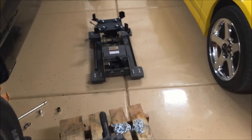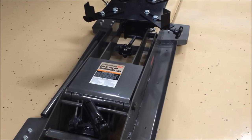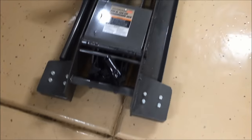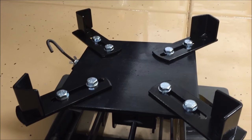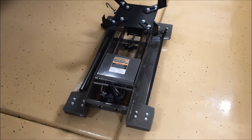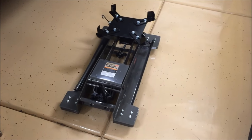One tool I would highly recommend for the job is a transmission jack. You're going to use this multiple times. They're about $150 at Harbor Freight, which isn't really a lot of money, and you're going to use it to lower the transfer case and the transmission, so it's really going to come in handy. It's somewhat similar to a normal jack but it just has a platform up here that helps you secure the whole thing, because you do not want that transmission or transfer case rolling over and falling down as you're trying to remove it. They are pretty heavy and it's hard to get under there in a good position. Definitely not a one-man job — you need at least two people — but with a transmission jack like this you can probably do it with one person.